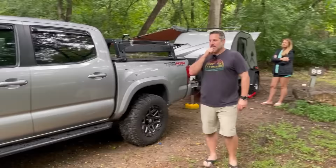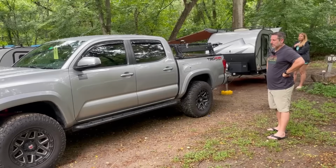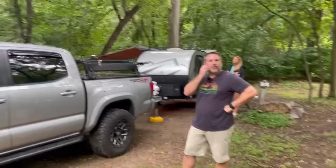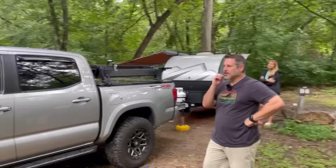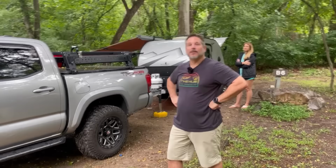Very nice. Now, something with a third gen Tacoma, since it's lifted and got heavier tires, I did have to put a KD Max tune on it to pull the camper. Yeah, so the camper's light, but anytime you go bigger with your wheels, heavier with your tires, it changes your gearing. So the KD Max tune, same thing as OV tune. Different flavor of it, and the biggest thing, it changes the shift points. Very nice. So now I can drive and keep a lower RPM at 70, 75 miles an hour.